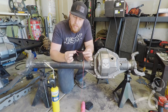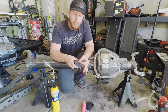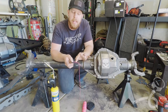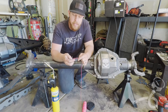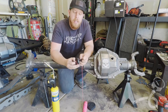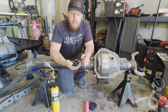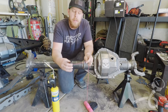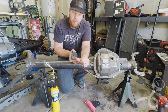So what I'm going to do is tie a small loop in the end of this close to the knot. Then it slips over this post, and that's what holds the line. And you can see the knot isn't quite at this hole here, and that's what you want. You don't want this to be loose, really. And now you can slip this in this little slit here, like that. You kind of saw it back and forth until it fits well. And then you just loop it through here and you pull tight. And now it is woven through this device and it puts the rope nice and straight right through here.